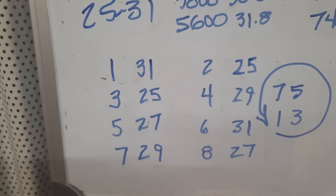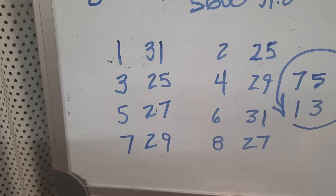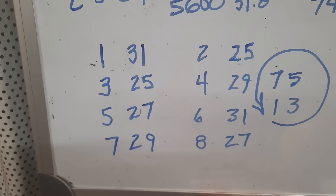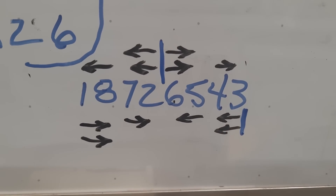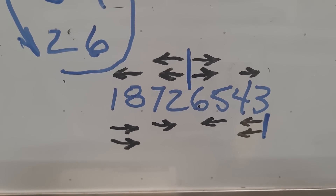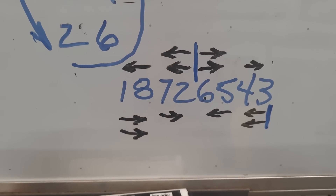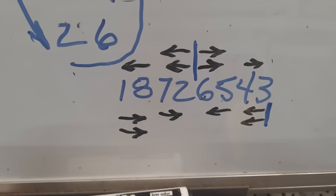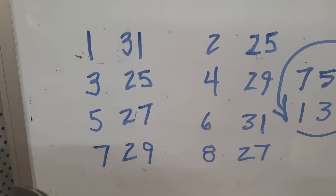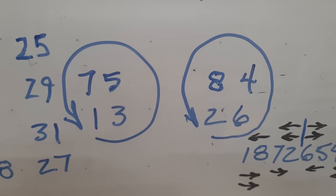The packaging headache with this variation in header tubes is that cylinders 2 and 3 are the shortest tubes, and cylinders 1 and 6 are the longest tubes. We came up with the two-inch incremental shift to have each pulse hit at a different time. The lead cylinder is the shortest, the trailing cylinder is the longest, with the two in the middle equally spreading that variation. We want to put them into the collector in a rotating position, and this is the pattern we chose.